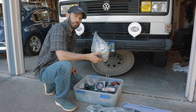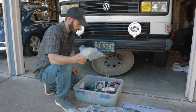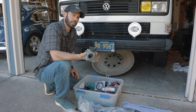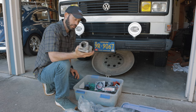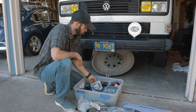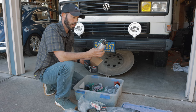We've got some wheel bearing grease to repack front wheel bearings, and our used front wheel bearings with both good races included. We've got an old water pump — almost brand new, replaced it on the old motor and then a few months later decided to rebuild the entire motor, so we tossed it in here just in case. Some more tape, a fuel filter, and a brand new Bosch fuel pump tested to make sure it works with factory pigtails wired so it goes right in.